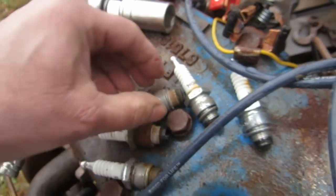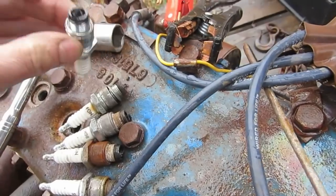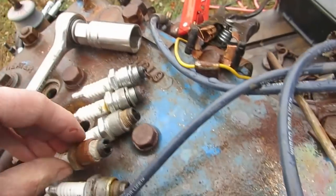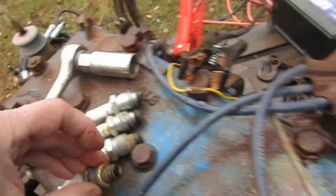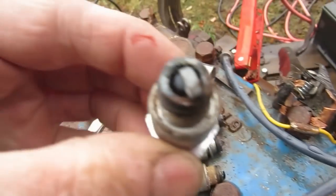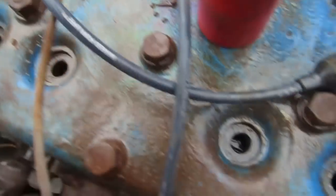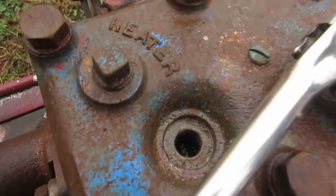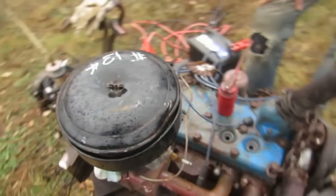But I'm really happy that it cranks over good. It means there's no real damage. And you've got compression in every one. Yeah, really good compression. No valve problems. Yeah, that's right. Then why are you taking the head off? Well, whatever. It's full of rust. The whole engine will be full of it. It sat around outside, so it's got water in it because those plugs were rusty on the inside. So if it had water, it means it's got rust on the valves.